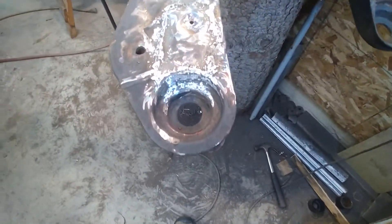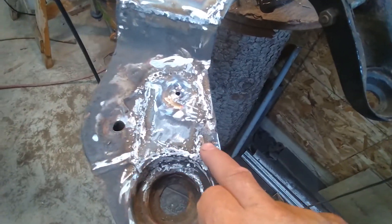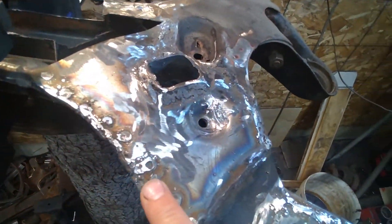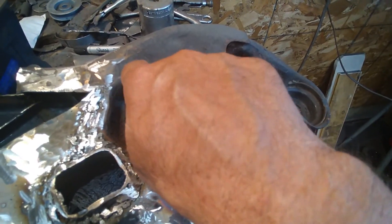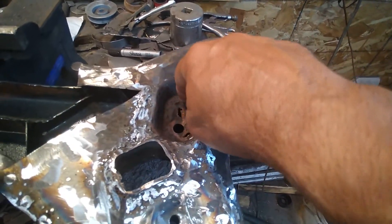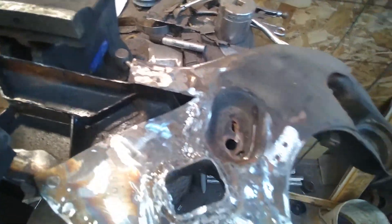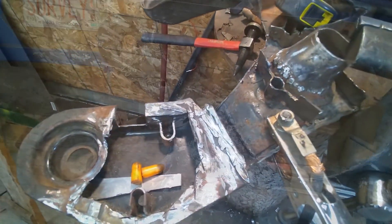There's the first arm pretty near done. This stuff is thick enough that I can tack weld the edges and then run a bead along the seams — same thing around there, a bead along there, and around all this stuff here. When I was checking it out earlier I thought that middle bit was solid but I'll have to do a little cutting and make it better. I'll check it out with the grinder and then on to the next one.